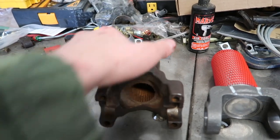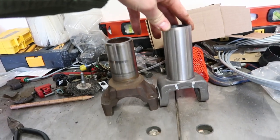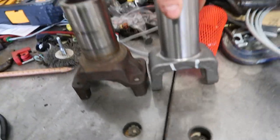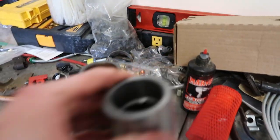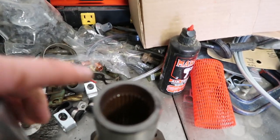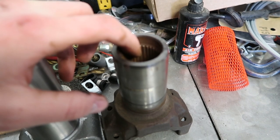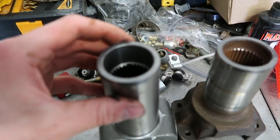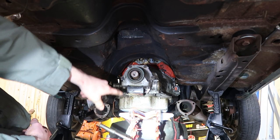There's a height difference, but that's also because this one is full and this one's open. The shaft itself is significantly longer, and you can see in here it is also counterbored — but this is right where that o-ring sits. This slip yoke will go way over the o-ring and allow proper engagement.